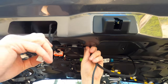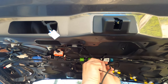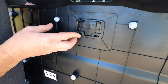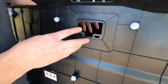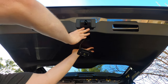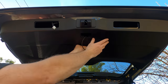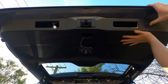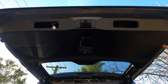Run the switch wiring through the tailgate and let it sit hanging out of the passenger side handle hole, then bundle up any loom excess and cable tie it to the factory loom. Move back to the large lower door trim and pop out the blanking plate from the inside of the trim. Lift the trim up roughly into position and thread the light out through the cover plate hole. Then refit the trim into place by sliding it into the slots next to the door lock and pressing the plastic securing clips back into place all the way around the trim. Just keep pushing all over the trim piece to make sure they're all clipped back in.